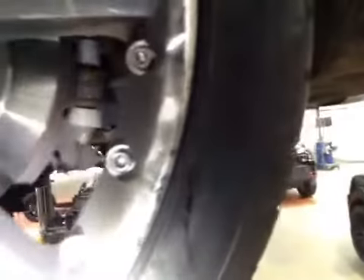Both of your rear tyres are in green. Your nearside one is in amber. Although the tread depth is still good at 6mm, there is damage on both, with some sidewall damage as you can see.